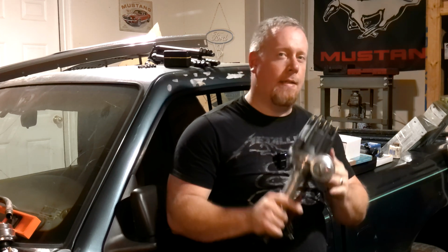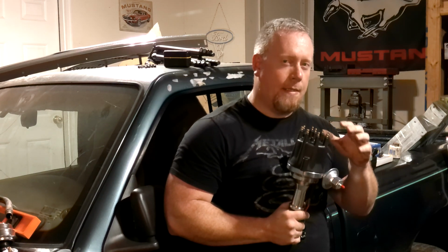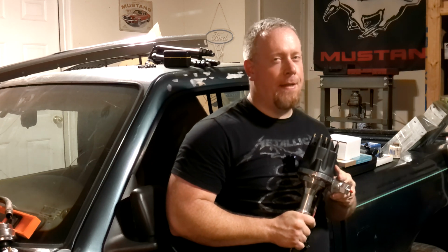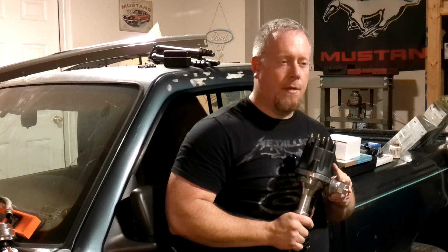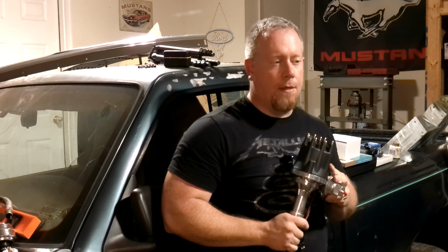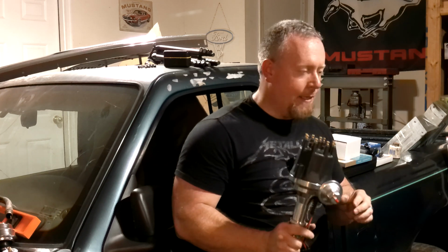So this thing looks fantastic, and the next thing I'm going to do is pop it open, see the internals, and set the spring rate and the total mechanical advance allowed to the maximum setting, because that's who I am. Honestly, I've seen most V8s love to have all of the advance in by about 3,000 RPM. It looks like the lightest spring would have that just shy of that, like 2,800 RPM or so. And that's probably pretty good. So I do think I'm going to get better performance out of this than I ever would have out of a Duraspark, and that really is the final reason that I didn't say before. So let's get started, see what's inside, and see if we can get this thing tuned.